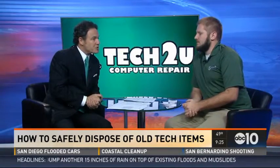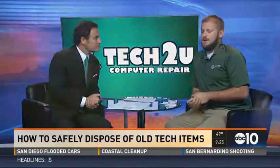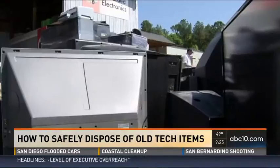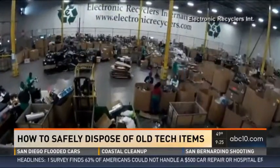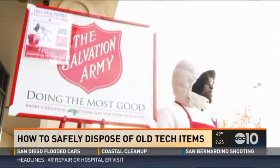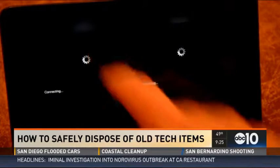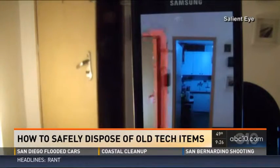Before recycling or donating computers, take precautions to protect your data. For a Windows computer, check out fileshredder.org — it'll overwrite the part of your disk where personal data is saved. For Macs with OS X, this is a built-in feature in the Disk Utility menu. For Android smartphones, find the Restore Factory Default Settings and also enable phone encryption so any recovered data will be useless. New iPhones automatically encrypt your data, which is a nice built-in protection.